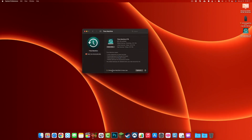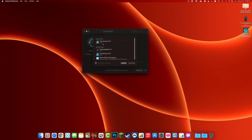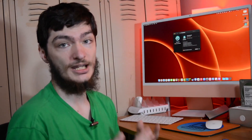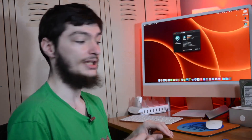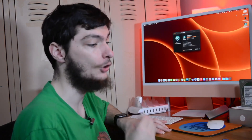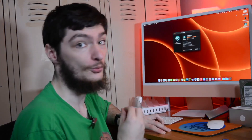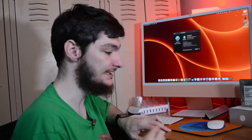Click it to toggle it. You're going to select disk and find your hard drive or SSD in the list, select it, then come back up to the top and hit 'Back Up Now.' Depending on how frequently you back up your Mac, this may take quite a bit of time. It's going to back up your Mac into a state we can pull it back from later. This is the most important part — if you don't want to lose your stuff, you need to do this.